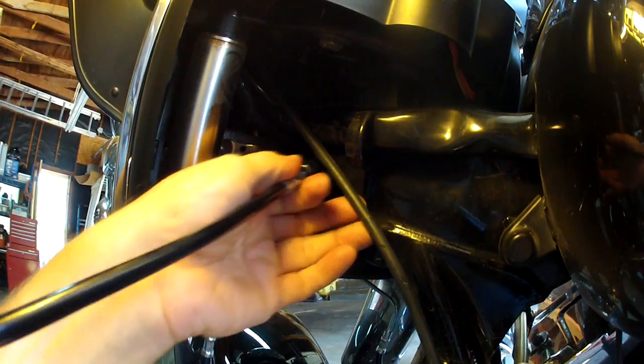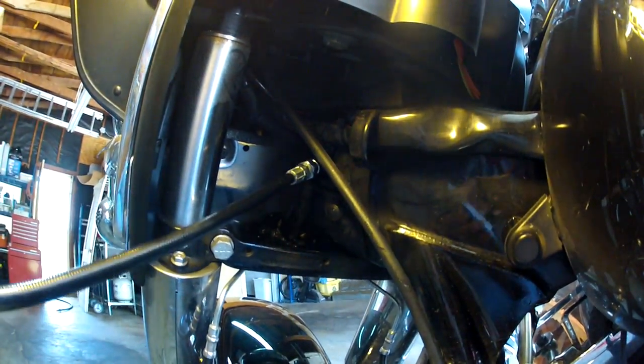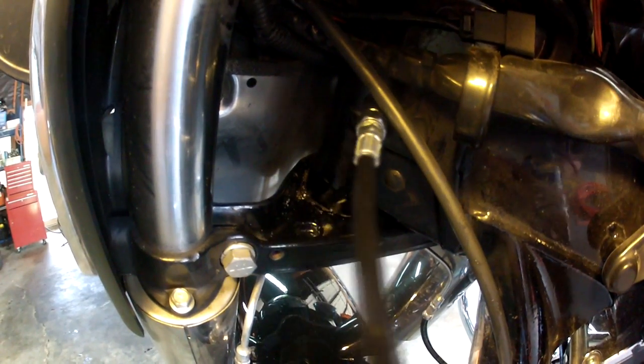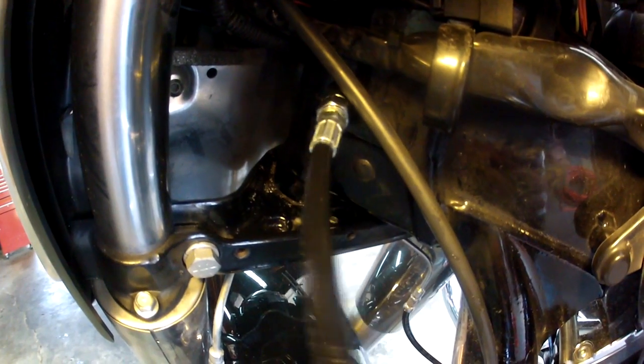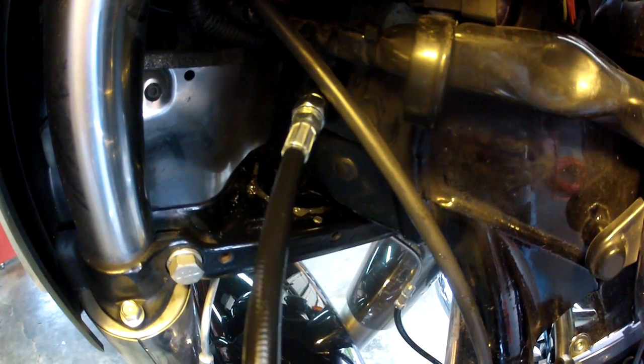I'm going to move this out of the way. I'm going to try to get it on. Here's your grease fitting. There we go. It's on already. Now, let's get Margaret in here, and let's try that. There we go. We're pumping. And you pump. It doesn't come out of the grease gun very fast. You can already see it start to pop out. Here we go. I'm going to pump again. There you go. You can see it coming out right down there. Once you get that out like that, and see a nice solid ring coming out, you're done. You can get in here and see the ring of it.